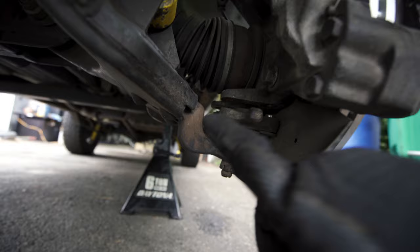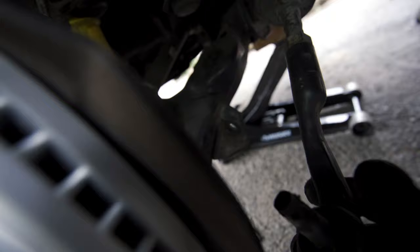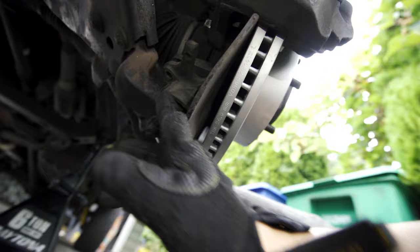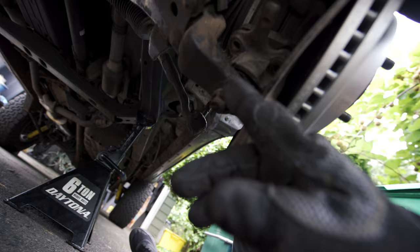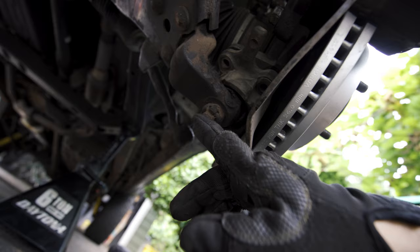So this is where we are now. We disconnected the four bolts that hold the lower ball joint in — it's hard to see, but there's one here, one here, and two on the other side. They're just 14mm. We also disconnected the tie rod using the ball joint separator tool, which helped a lot since it was just super stuck in there. The last piece is a 24mm nut that holds the lower ball joint into the lower control arm.